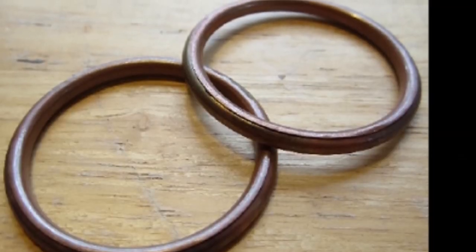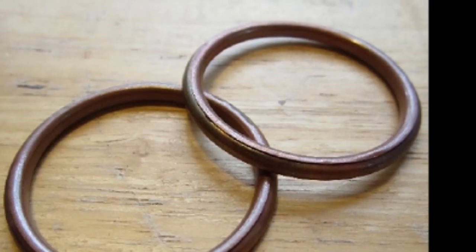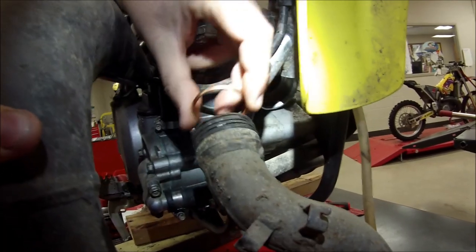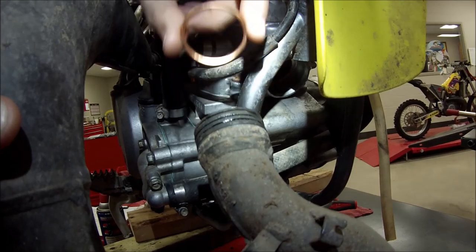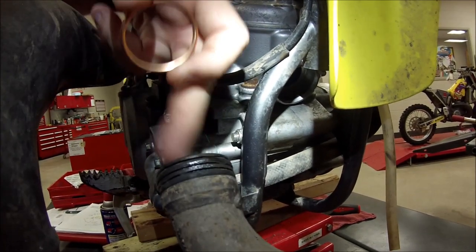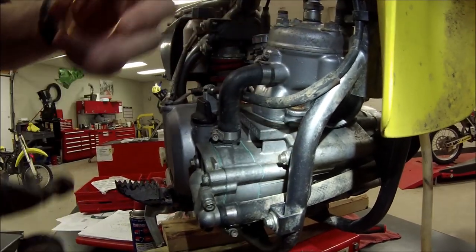Here's a close-up of both sides of that gasket. The one to the right clearly has a seam on it. You've got to think about what's happening here in this exhaust system — this gasket is getting sandwiched and we don't want it to leak. The exhaust flow is coming out of the cylinder head and into the pipe and out, so the pressure is going this way.